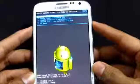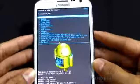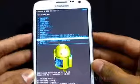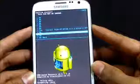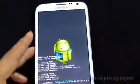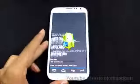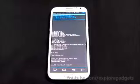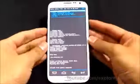Choose from external SD and select the Slim GT-N7100 4.2.2 zip file, then hit Yes to install. Wait for the installation to complete. Once done, go back to Install Zip from External SD Card.